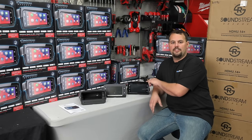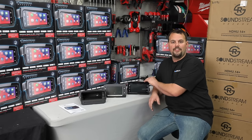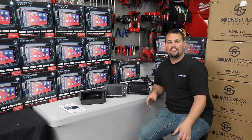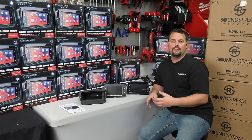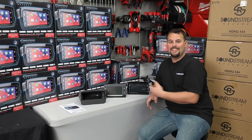You'll never have to flash the Soundstream radio to fix an audio issue. It's going to come with a flat EQ curve already there, but it has 10 bands of graphic equalization that you can adjust. So that gives you a lot of bass adjustment, mid adjustment, and treble adjustment. Not three bands like a stock Harley radio, but 10 bands.